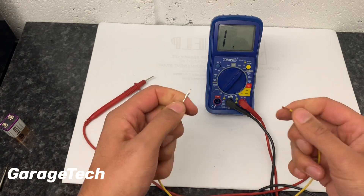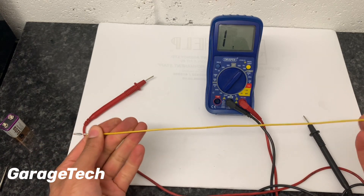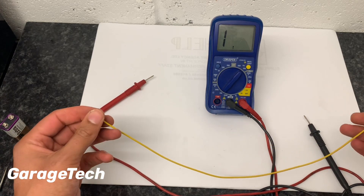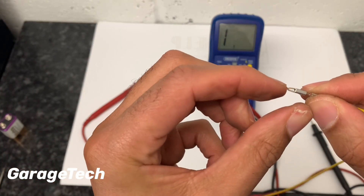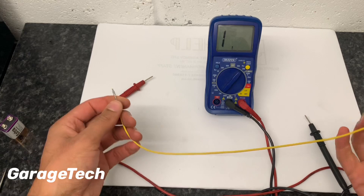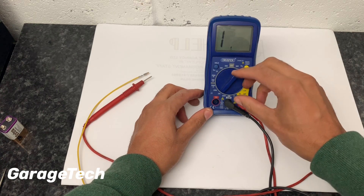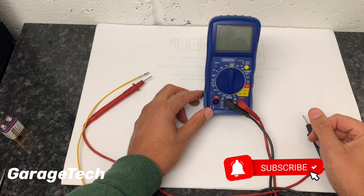So that's a quick test if you've got any electrical problems and you want to check a piece of wire using the resistance check. As I said, the best thing to do is disconnect it at either end first, check that the terminals in the plugs are correct and not bent, and that it's a tight fit — there's a little gap to check to make sure it's nice and tight when checking any connectors. That's it guys — a quick overview of voltage and resistance on a multimeter. Thanks for watching, and if you like this video and want to see more, hit that subscribe button.